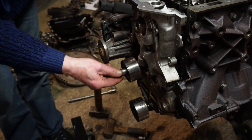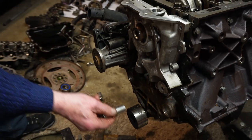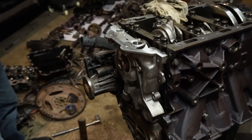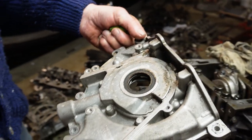You've only got to take one arm off — these are the idler wheels. Just pull it through the timing belt. Now your pump housing should come off.